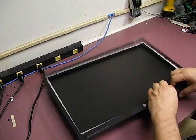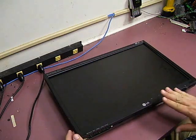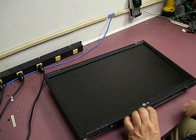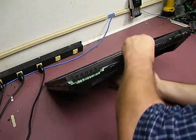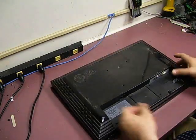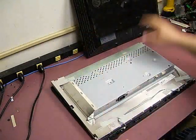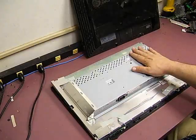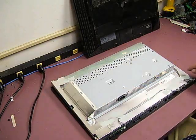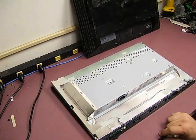When you get to the corner by the power supply and the power switch, just pop it up and then you're finished. Before you pull the front panel off, you need to turn the unit over because you actually take the back of it off first. So we'll turn the unit over and remove the back of the case. Now you can see the RF shielding that covers the video control portion and the power supply portion.